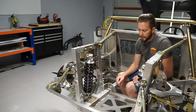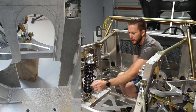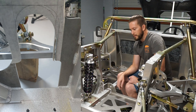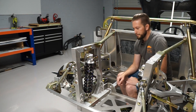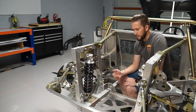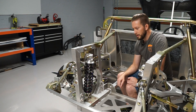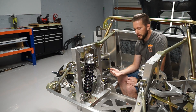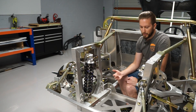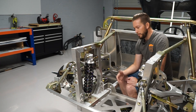In order to do that, I needed to trim about 10mm — say half an inch — off the rear vertical edge, and about 15 to 20mm — almost three quarters of an inch to an inch — off the top, to increase the height of that arch. It took a bit of effort and was awkward, but using some basic tools I was able to mark everything out with a really nice neat line to follow and trim it all back so that it looked like it came from the factory. I didn't want it to look like a hack job — it needed to look like it came that way for me to be happy with it, and I'm pretty happy with how it's turned out.